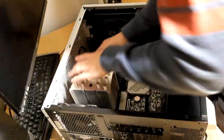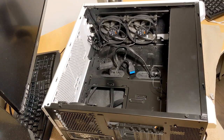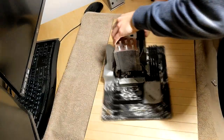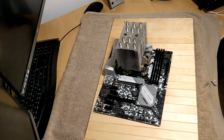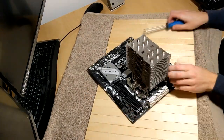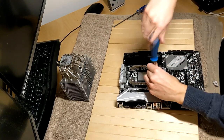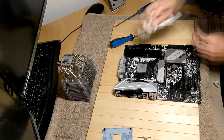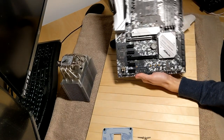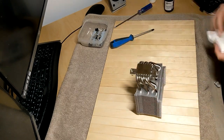So it was time for a motherboard transplant. This was quite a hassle as almost everything had to be disassembled apart from the power supply and all the cables. I decided to just disconnect the motherboard with all of the peripherals apart from the GPU still attached to it. Once it was removed from the case, I removed the RAM and took off the CPU cooler. After that, it was time to clean the CPU with some isopropyl alcohol. Now that everything is disconnected, I can also properly clean the parts including the CPU cooler, which was just covered in dust.